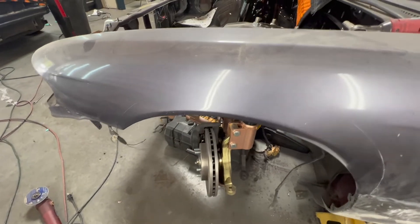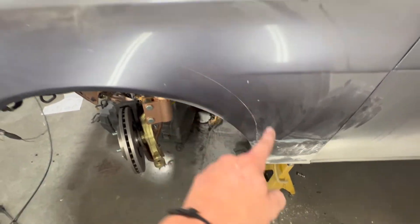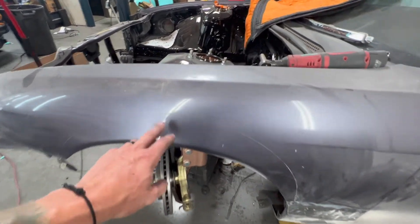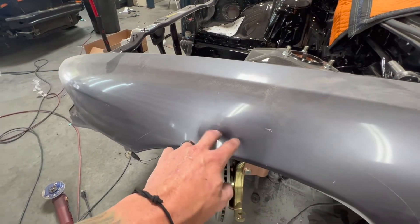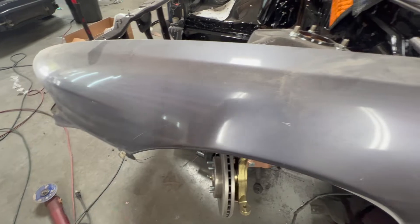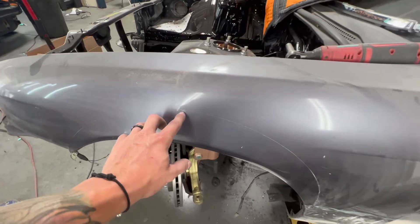This is the way I marked it. I copied the distance from how much I cut here and from where it ends — basically just three measurements: corner, upper corner. You just scratch it up right there so you know you need to cut somewhere right here, to give some room to weld on — maybe a quarter of an inch right there — and just cut the line straight under it. That's pretty simple: cut it off, then mark the fender a little below this line.